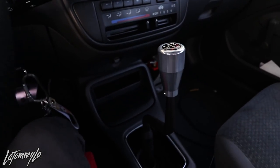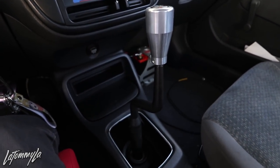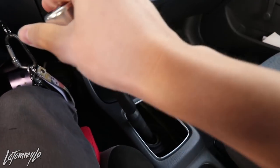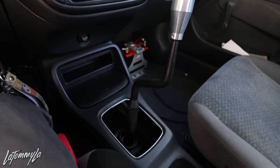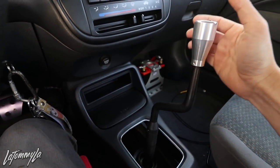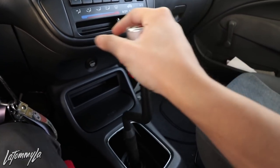Look at the play that this thing has — it hits and then it's hard finding the gears. Luckily Kevin had a bunch of bolts with him, so I used a long 10mm bolt with a little nut. Since there's a gap it caused a lot of play, but it was just so I could drive home because no one had a hammer, and there was no way to use a hammer and get enough leverage.